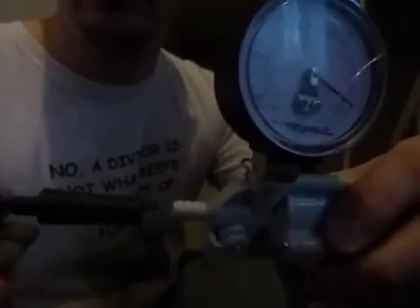Here is the unit. Let's take off the air filter and check out the vacuum with this vacuum pump - the needle will indicate the vacuum. I found the fitting which happens to fit on any of these ports. There should be air sucked in through port B, but there isn't - vacuum is increasing when it shouldn't be. So port A is not behaving correctly; it's making vacuum where it shouldn't.